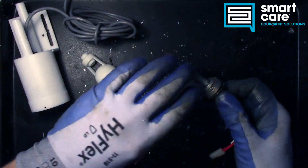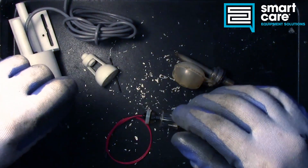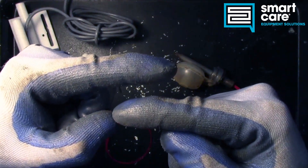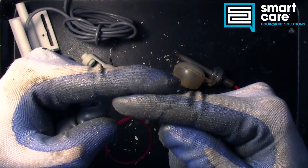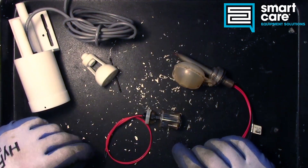The old design, prior to having the magnetic Hall effect sensors, was to use very small metal plates inside a sealed tube, and they would actually physically come together when the magnet got close to them. You'll still occasionally see those out in the field. They're not super common anymore, but they are still around.